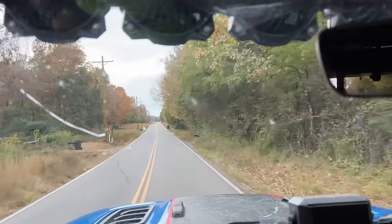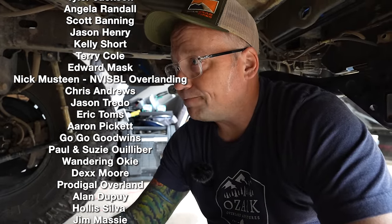This is what it should sound like. Be sure and subscribe, follow along in the upcoming adventures, and we'll see how well this is doing. Hopefully between now and next year I won't overheat the diff and deal with that whining noise again, because that would suck. So if you are considering re-gearing your Wrangler JL or JT Gladiator to deeper gears — 513s, 529s — and running larger tires like 37s, 38s, or 40s, then get an aftermarket diff cover that holds more fluid for cooling purposes, because it is apparently a common issue with JLs and JTs that larger gears and larger tires cause the rear end to overheat. Ask me how I know.